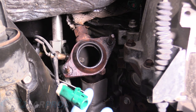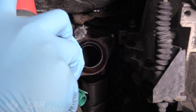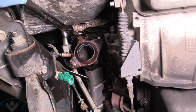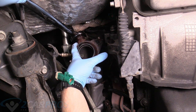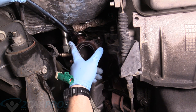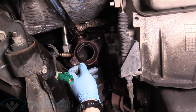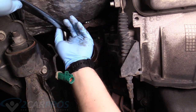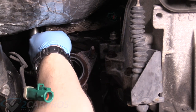All right, so the next thing we need to do is remove this fresh air pipe, but the first thing we're gonna do is hit it with some WD-40 and let it sit for a little while. Okay, so we have an inch and a 16th wrench on the top fitting of this air hose here, and it's important to note it does have a secondary fitting that actually goes into the exhaust manifold, and if that starts spinning together, you're going to need to grab an air hammer and hit the opposite sides of the left side here, so it'll spin into the manifold while you are trying to loosen the top here. They can be a little tricky and a little stuck and completely terrible. So now it's pretty loose. I can actually take it off by spinning it by hand here, and it's off.